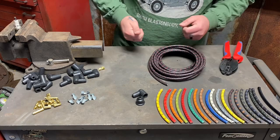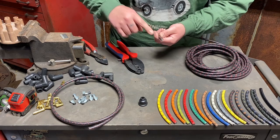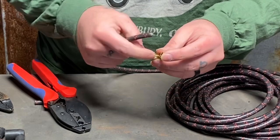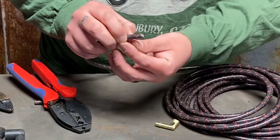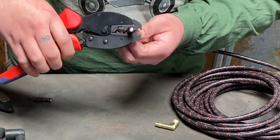I'm going to show you how to crimp and strip the distributor ends correctly so you don't damage the core inside. If the core gets damaged you have to cut that end off and strip it again. The amount you want to strip is almost twice the distance of the crimp itself. Eyeball twice the length of the crimp portion, mark that with your finger, then use your stripper — the specific end shown here — and work it around in a circle to cut through all the insulation.